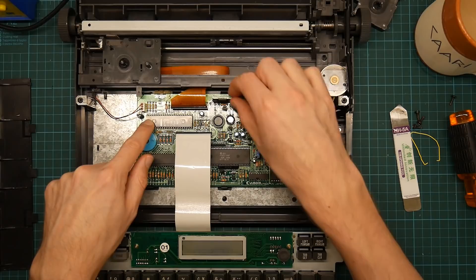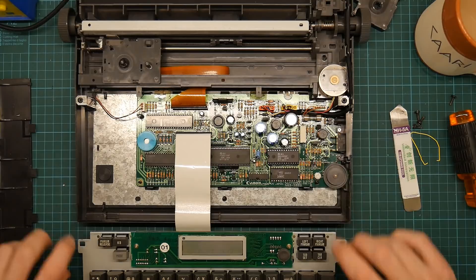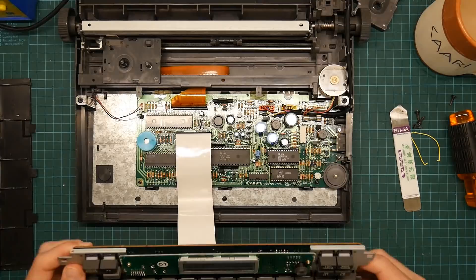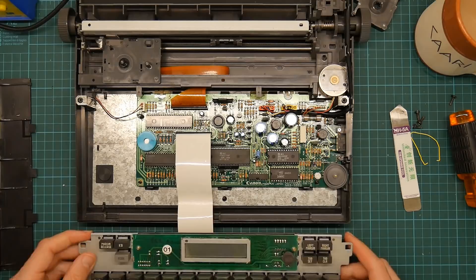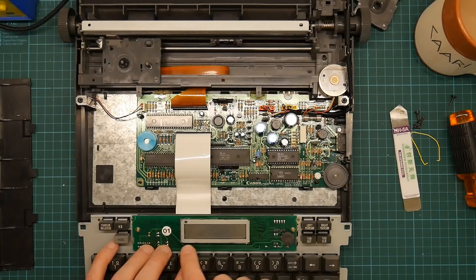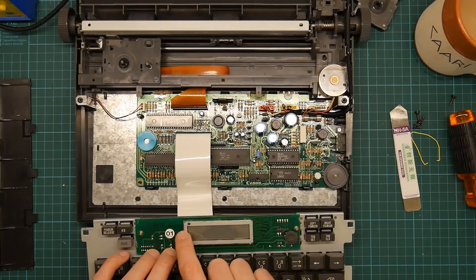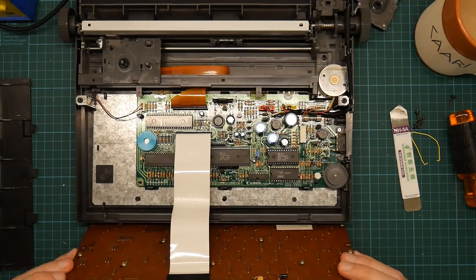This is 64192 in an interesting package with a groove down it. This is the print wheel for the print quality. Power supply, nice fuse. There's a big chunky power controller here that could be running the print head. So what have we got on this? The little LCD is probably a complete pain to drive. It is bespoke with baked-in symbols in the boxes below, but the top line is alphanumeric. So if I were to reuse this as a PC keyboard I could potentially make use of that, but figuring out the protocol would be exciting.